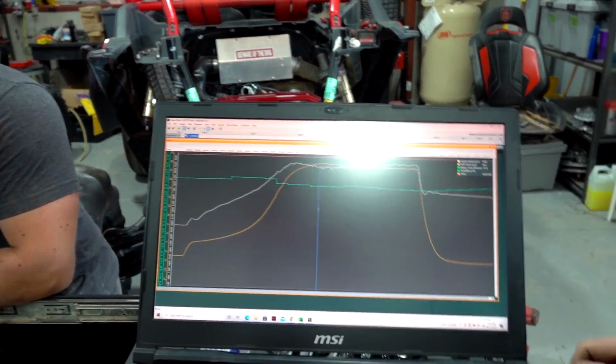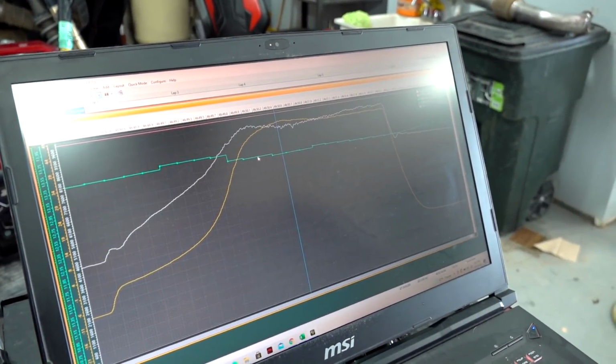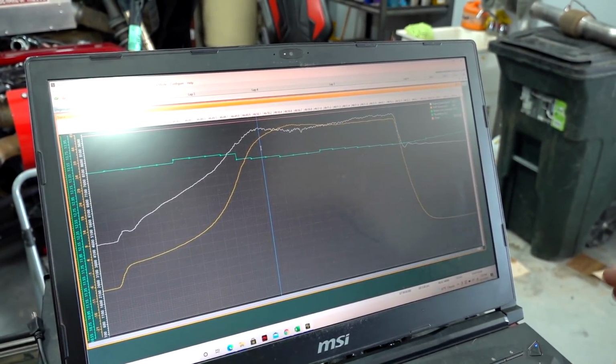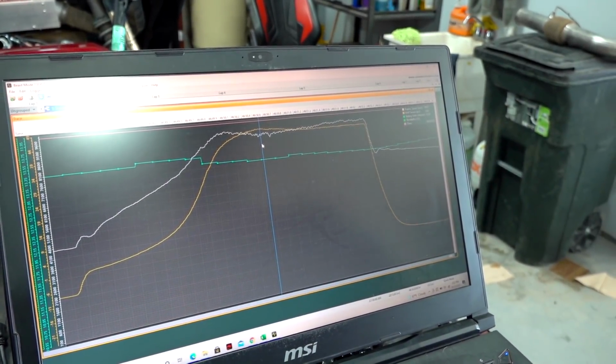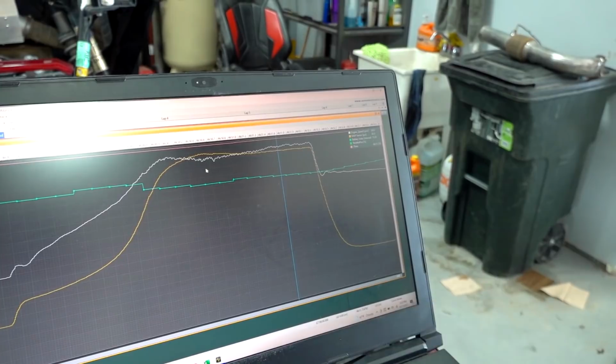Yes. Color glare, there we go. Really good looking data here. Basically, RPM, kept it real simple. We're just looking at RPM and boost here. So the RPM trace basically matches what we saw on the dyno. Which makes a lot of sense. In terms of boost, our initial peak was right around 45 pounds. That's way more than. Yep. We hit 45 pounds, and then during the pull, we leveled out right around 43.